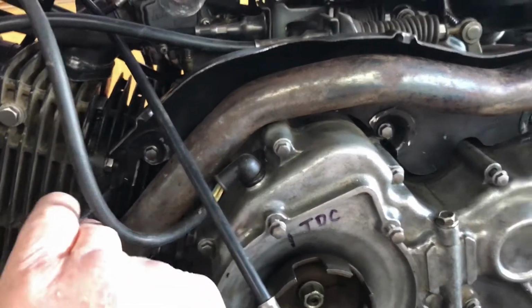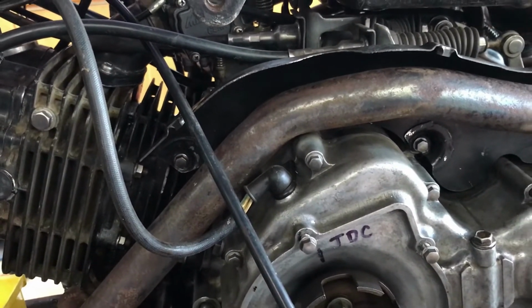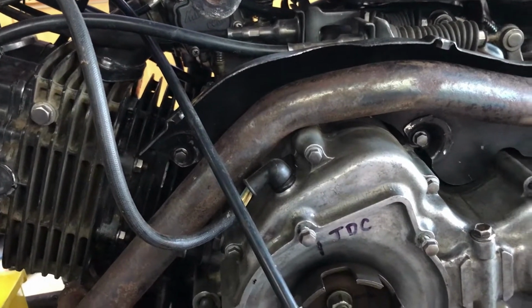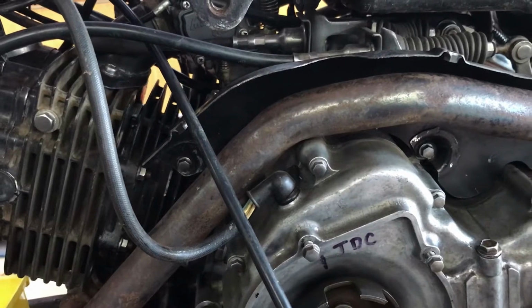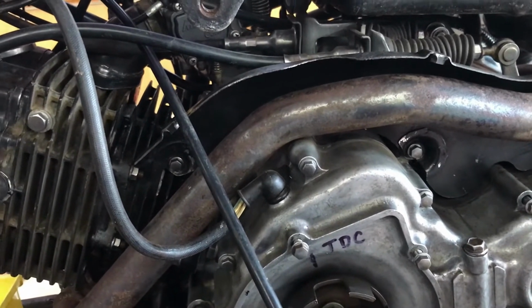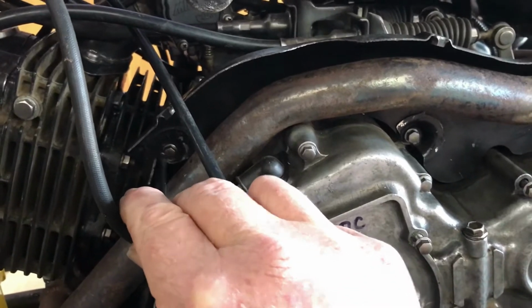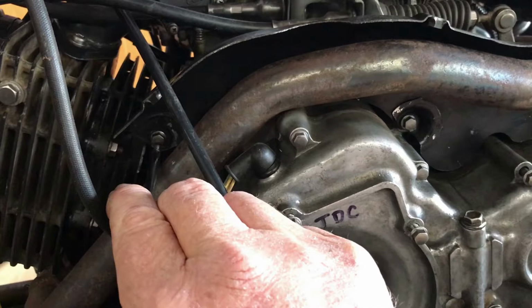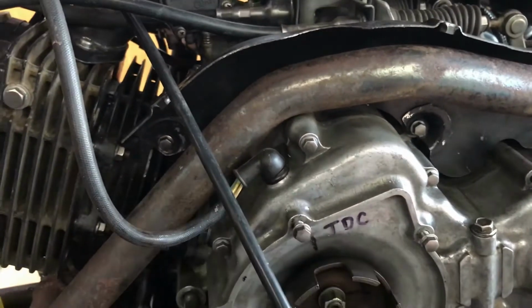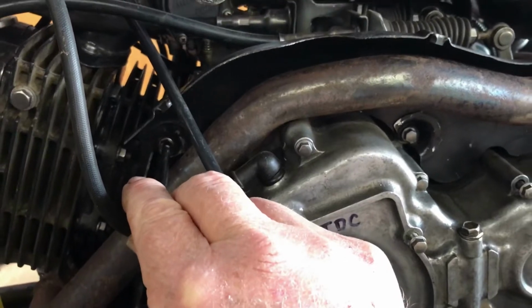I don't have the cylinder off the 94 bike to even compare it with, because the 94 bike cylinder, I believe, was destroyed in the blow up of the engine, and I didn't get it and never saw it. But I do know from this bike, when I went to mount this cover, that the boss was there for that screw, but the screw hole was not drilled and tapped to take a screw there.